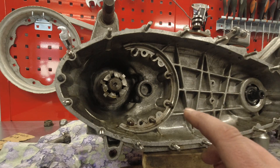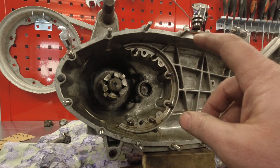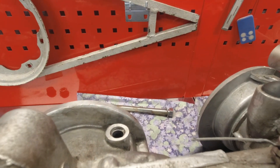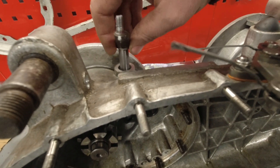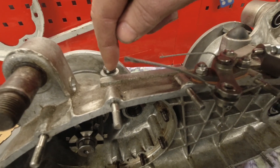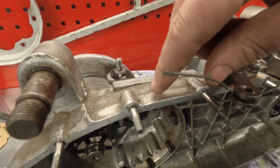One thing you need to note before you start stripping your gearbox: the easiest way to do this is to select second gear and keep it there. I'll show you why. The aim of the game — and this is also for five-speed gearboxes — is that when you have selected second gear, if you slot down your shifter so that it is as parallel as possible to this lug on the engine, then you should be in the ballpark. So let's attempt to fit it.